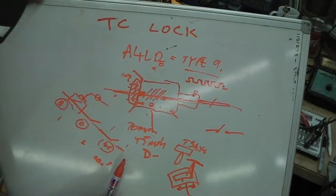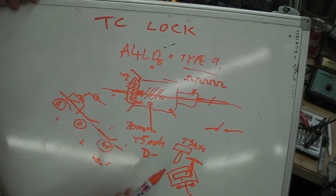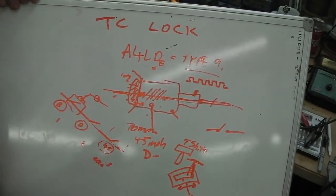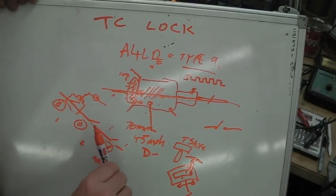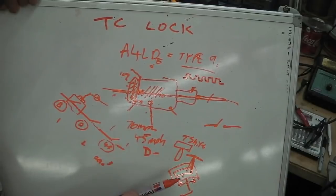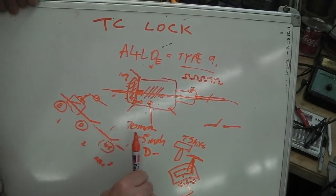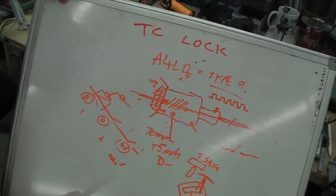So I would go over 45. This would come on as long as these conditions are met with those switches. I drop back, say, to 40 mile an hour before it clicks back out. So when I'm drifting between 45 and 40, that's the operation, and anywhere over 45, it's going to stay engaged. So that's what we have to do.